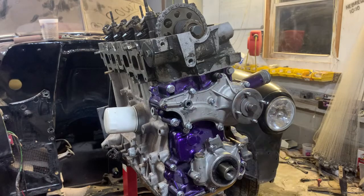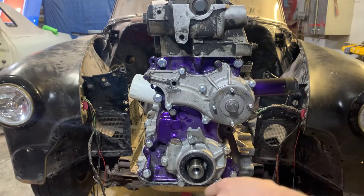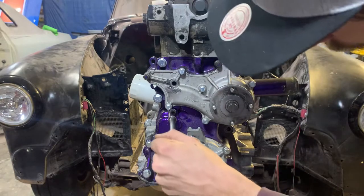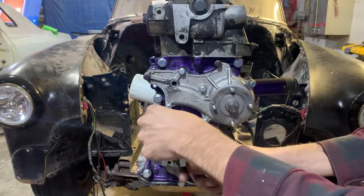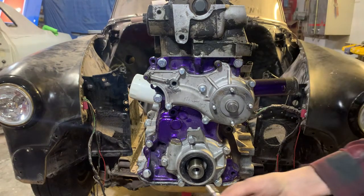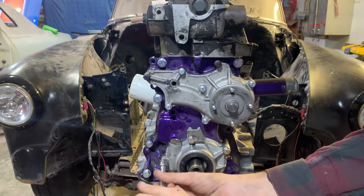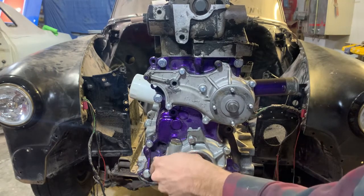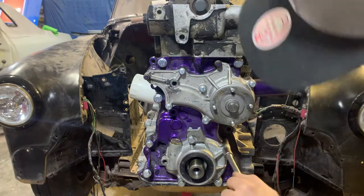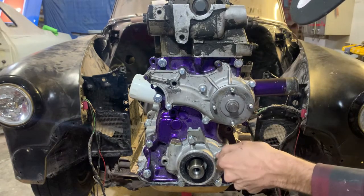I'm about to change angles and then I'll take the rest of the timing chain cover bolts and the oil pump off. Pull out all the 12s. There's one. This is LCE hardware that I bought. LCE is pretty nice for parts for this. They got every little thing you need. I got a cam bolt for like $7 because I lost mine out of my other truck. Sponsor! Yeah. But the only two bolts you need to take out of the oil pump are this one and this one, unless you're replacing it also, because these are the ones that go through to the block.